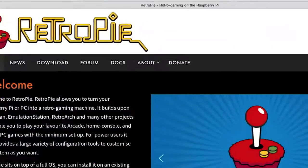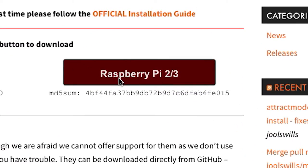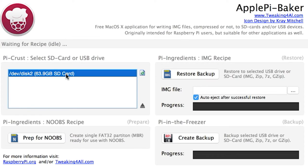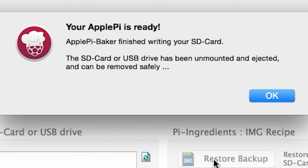Once you've got everything ordered, head over to the RetroPie website and click the Get RetroPie button. This takes you to a page where you can choose the image for Raspberry Pi 2 and 3. Start the download and save it to your hard drive. I'm using a Mac, so I'll use a free program called Apple Pi Baker. If you're on Windows, use Win32 Disk Imager. After downloading, connect your microSD card, open Apple Pi Baker, make sure your SD card shows up in the left window, go to Restore Backup, locate your image file, click Restore Backup, and watch the progress bar as it flashes to your SD card. Once finished, eject it from your computer.